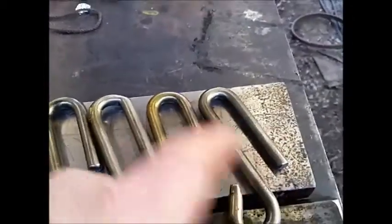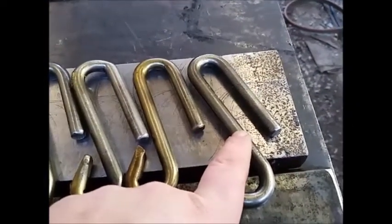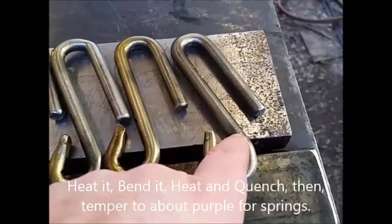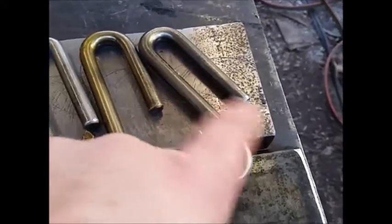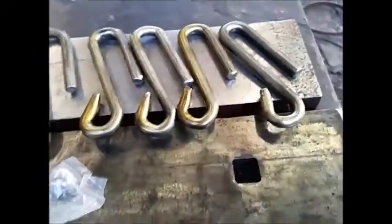You can take it a step further. You can drill a hole here and here on both sides — just a little small hole — and get a piece of spring steel. Bend it out, go over, bend it, go down, come right back up, go through the other hole. Go through one hole, space the other hole about an eighth to three-sixteenths inch apart, and go through the other hole on the way back. When you push it back and let it go, there's no way you can turn the vehicle upside down, shake it, put it in the wash machine — couldn't get it off. That's really not necessary, but I have seen chains like that.